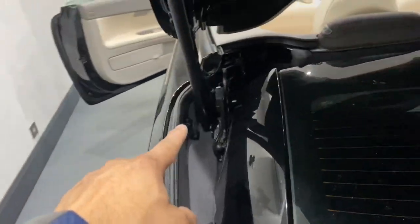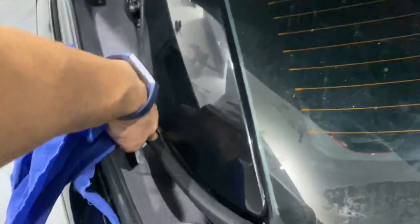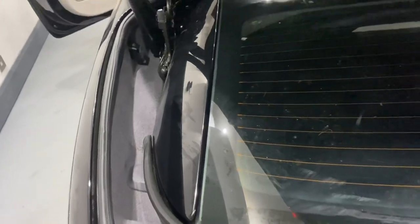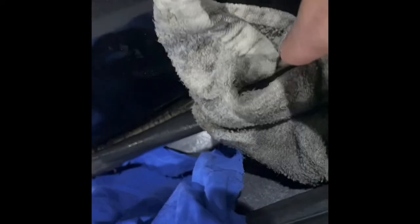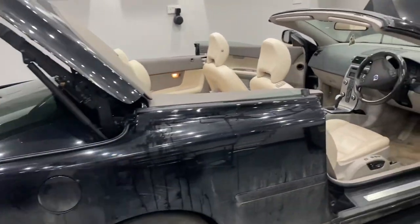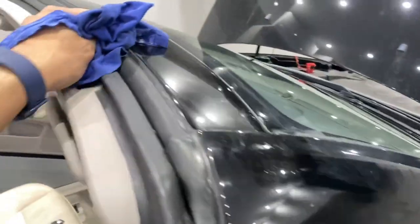Come around to the back to get the interfacing parts here and the seal along the back of the tailgate. You've also got great access for cleaning this seal here, and you'll normally find a lot of debris building up in here. To remove it, put a rag at the bottom and a screwdriver wrapped with another rag, and push it through — getting all the rubbish out. Once the seals are all cleaned, take a clean rag and wipe them all down to get the water off and dry them.